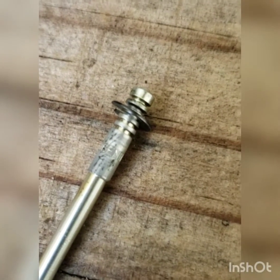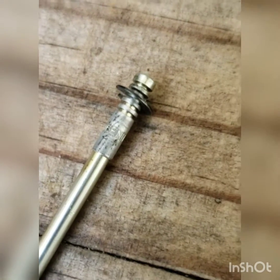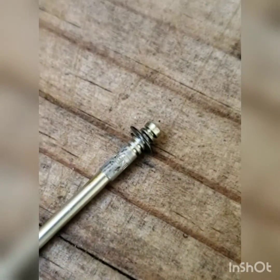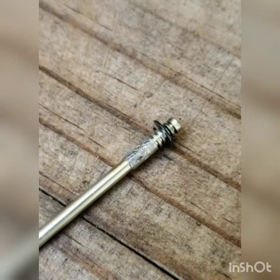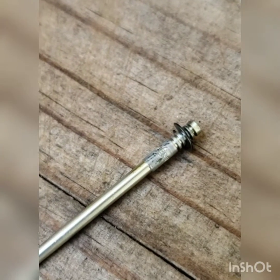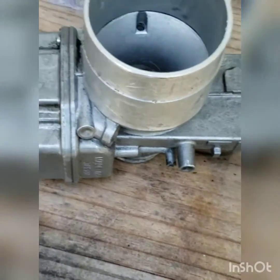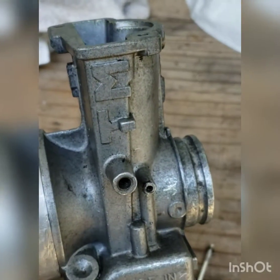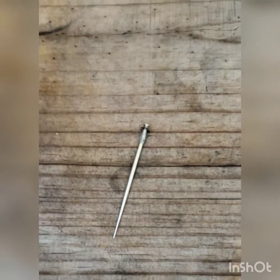With that being said, mine is on the third clip, and since it's actually bogging out around higher mid-range RPMs, I'm going to switch mine one clip up, which will make it a little leaner. So if you're having that problem, definitely with a flat-side carburetor or any carburetor, check your pin.